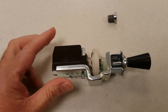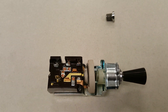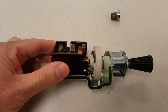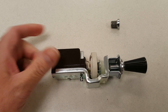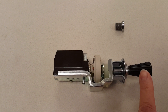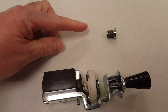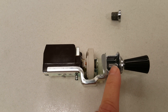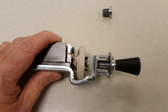Here I wanted to show you the 1970 headlight switch with the spacer installed. That will push it back a little bit further from the dash to make up for the longer knob and shaft — this is a three and a half inch shaft. The stock F100 was two and a half inches, and this is the stock bezel retainer nut. The one installed is about an inch longer to make up for the longer handle.